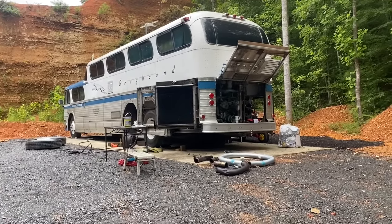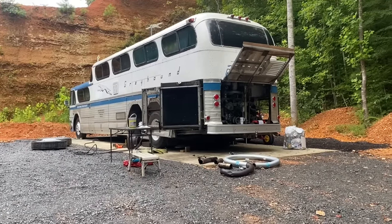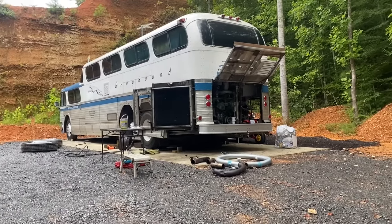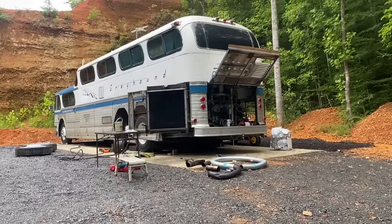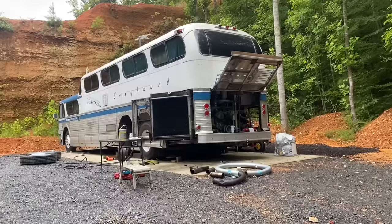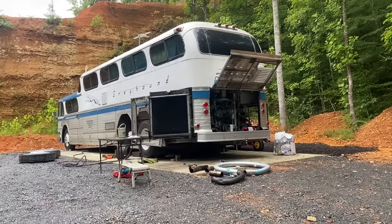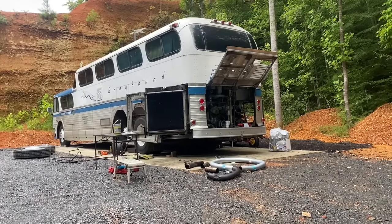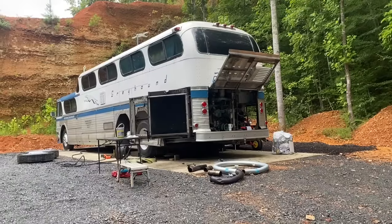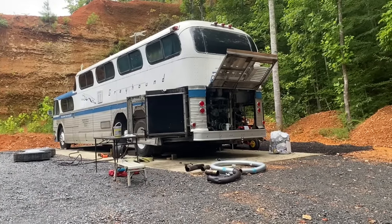We went ahead and bypassed the injector on that cylinder, so no fuel goes to that cylinder, and it stopped the smoking. It no longer smokes there. I'd give him 95% chance of making it back home without a major engine issue. He's already driven over 100 miles with it down a cylinder and nothing major happened. With the cylinder bypassed, the oil's not getting diluted with unburnt fuel and that kind of stuff too. So I think he's going to be okay with that.